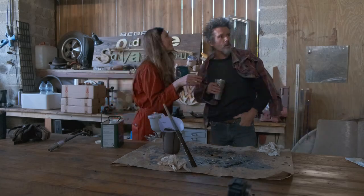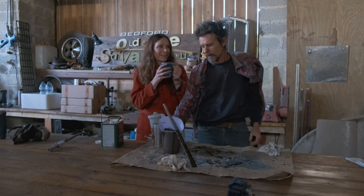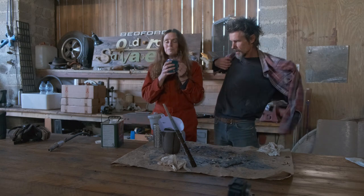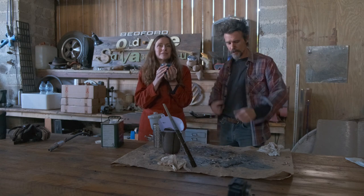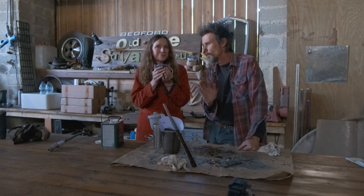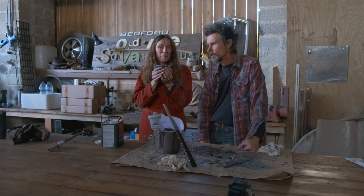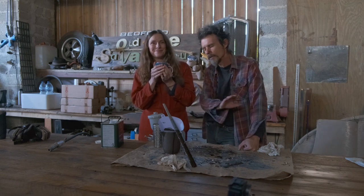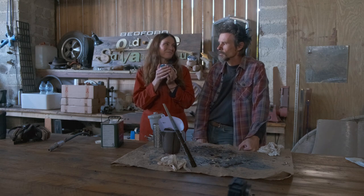Right, what is it? 4:45, just as it starts getting dark again now, and we've finished up. On this last bit, there's potential that some of it might have to get sanded should the finish not be very good. I mean, we're talking really fine sanding and then polishing. It's had 3 coats on all of this bit, so most of the rest of it's only had 2. There were places where I put an extra coat, like on the dashboard top and around the frame. So yeah, 3 full coats we just did.